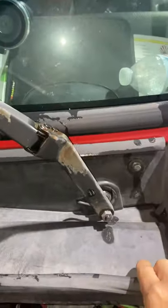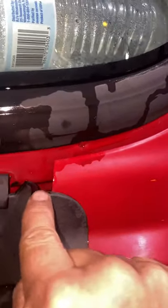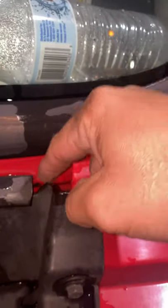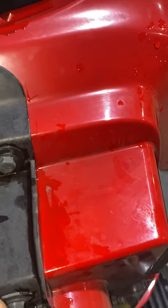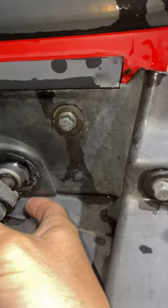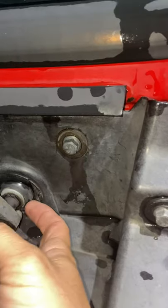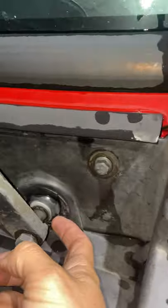This splash guard goes all the way from one side to the other. The drain will be right here and also right there at the very end. This right here is bad design from Volvo — it's not needed, and that's your problem. Water is basically coming in through here and going to your electrical harness, the pass-through harness. I also just realized — take a look at this — water can also come in through here.